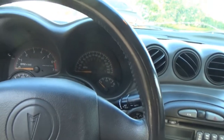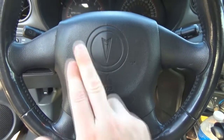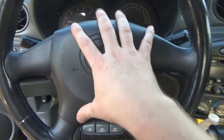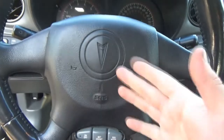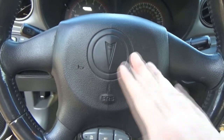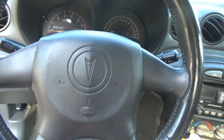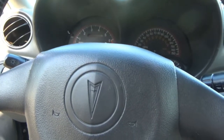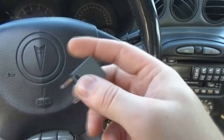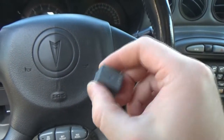Now, if you have a problem with the horn sticking, it very well could be that the contacts in the switch inside your steering wheel are grounded. Or you could have a wire that's pinched, possibly, so you have a short to ground on the switch. Or the relay itself could also be bad mechanically. We obviously know the relay works because the horn works.